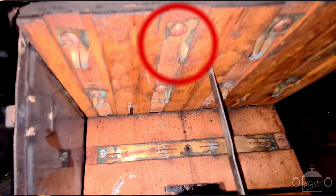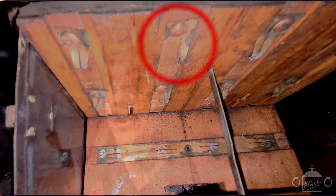As you have just seen, there's actually nothing at all wrong with those coils as it turns out. But on closer inspection of my coil box at home, I have actually noticed that one of the contacts for one of the coils is actually broken. It's not broken to the point where the coil won't work at all, but it is broken enough that it's causing the coil to be powered intermittently, which is obviously not good. So as well as the wooden coils, I've also picked up some new contacts and porcelain tubes, and that'll be another video coming up - to rebuild my coil box.